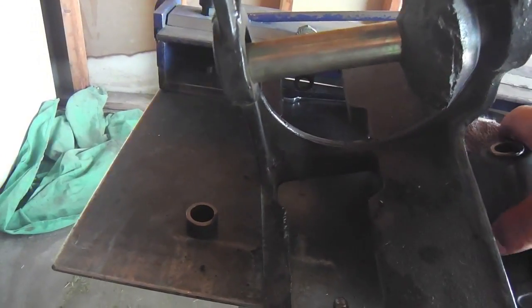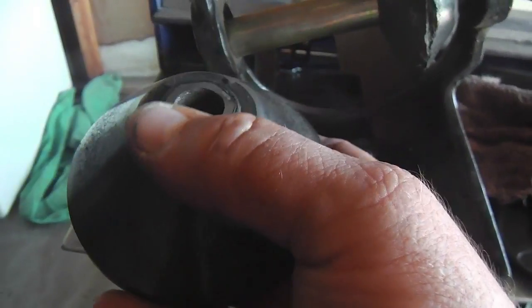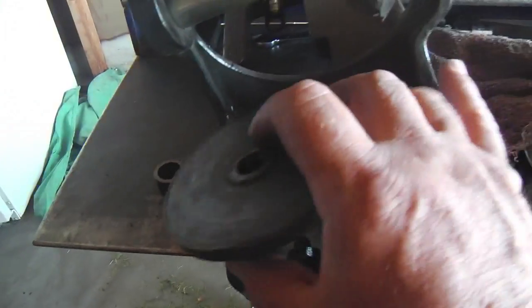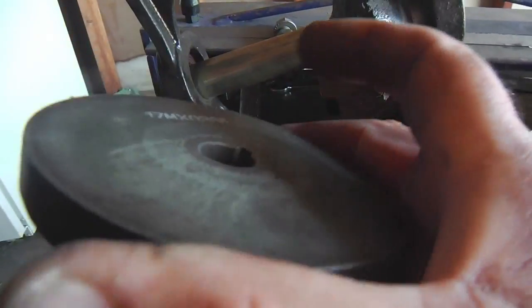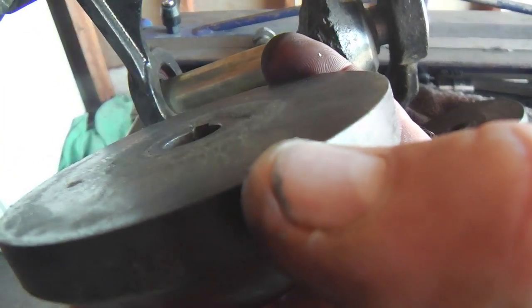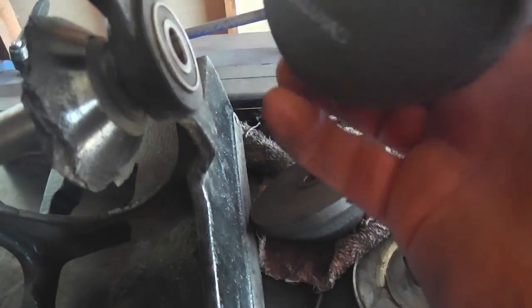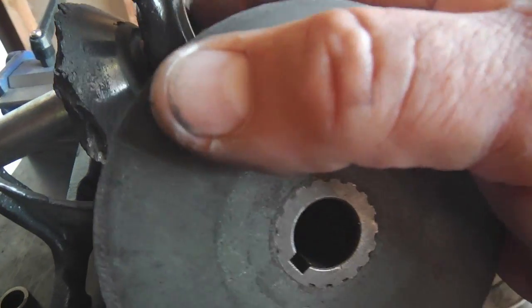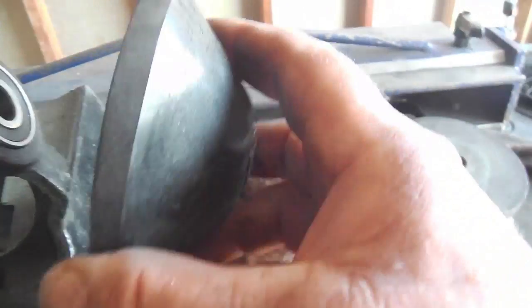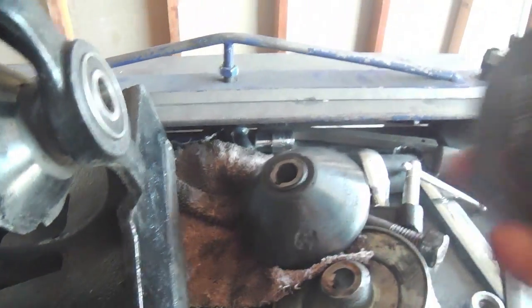And so what I'm going to do on this one, because I noticed, see, this is the old cone. This is the upper one. This is good. I shaved off a little up top. But on the underside, you see that lip there. And that's why, as I mentioned before, this one has more skirting, because that lip isn't there. They filled that in with skirting. And guess what? When you put the shaft down through the sleeve of the cone, and this sits up on top of that bearing, I'll use that word again, it impinges. The cone material itself impinges on the bearing, not just the inner race, where it would on the old one. See, the inner race sets up on the bearing and doesn't impinge on the rest of the bearing. So that was a good thing. This is not so good in that fashion.